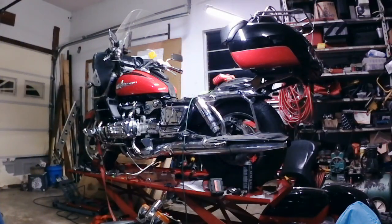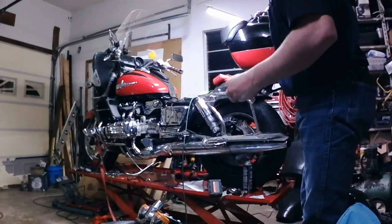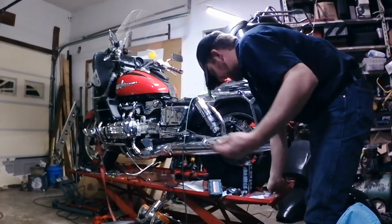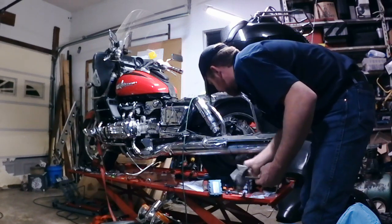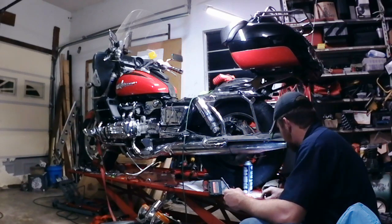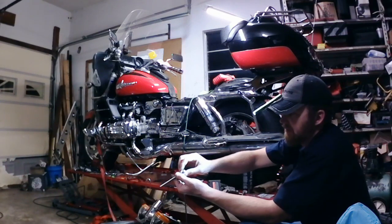I need to grab the bag mount for the other side. The bolts that I'm using for this, and I know some of you are going to scream blasphemy here, so I'll live with that, are stainless. The fronts are 5/16 18 by 5. Now, I'm going to cut these down. I can't leave 5 inches stuck out. But the reason I got 5s is because I couldn't find anything in the range of 3.5 to 4. The front bolts are 5/16 by 5, and they're stainless bolts, stainless washers.